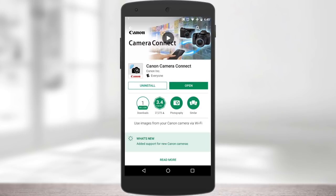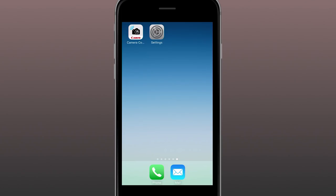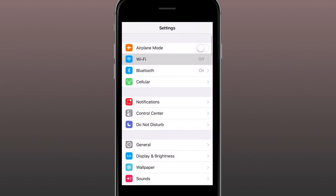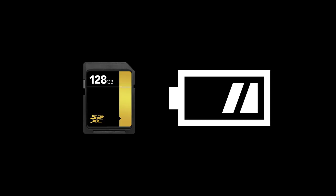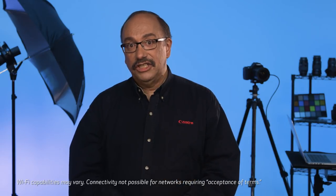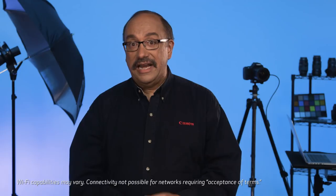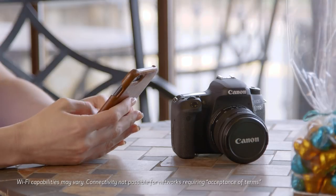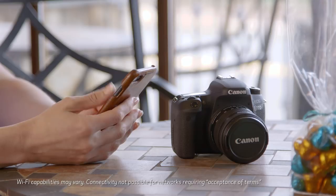Be sure to get the genuine app from Canon Inc. If you've got an older version of the Canon app on your smartphone, upgrade it so it will work with the EOS 77D. Before you start, go into your smartphone's settings area and ensure that both Bluetooth and Wi-Fi are turned on. Make sure your camera has a memory card installed and that your camera battery is fully charged.